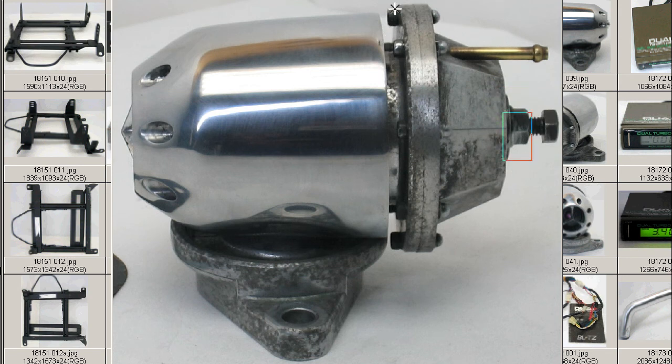So when the boost is enough to overcome the resistance of the spring, the diaphragm will move back in a sequential manner and pull a little piston, which allows the boost to squeeze through the front, making that distinctive HKS SQV sound.